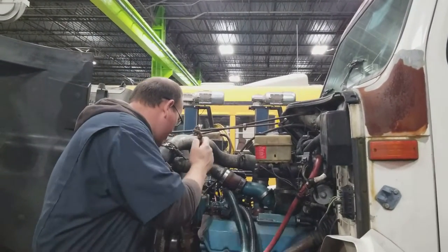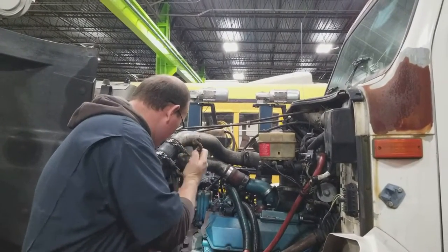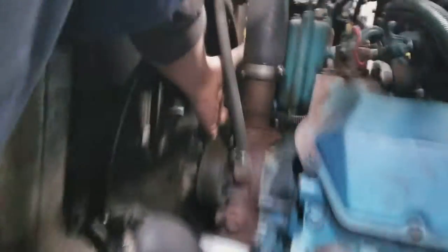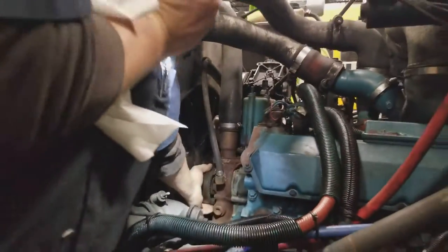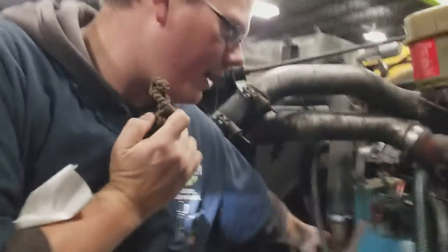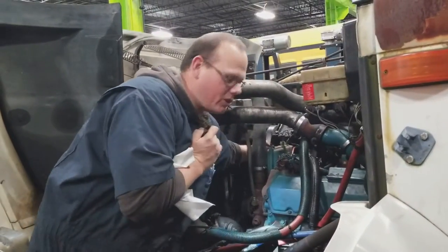While you're over here, check your grease fittings and check the condition of the engine. Since we're over here, check our belt. Right now I'm just doing a hand tension — if it was really loose I'd get in there with a tool, but this is actually nice and tight. Get a rib gauge out if you can feel a lot of wear. Check the condition of your belt. The tensioner's good.